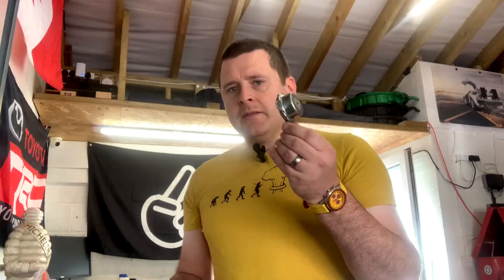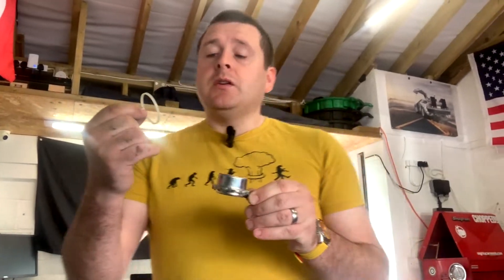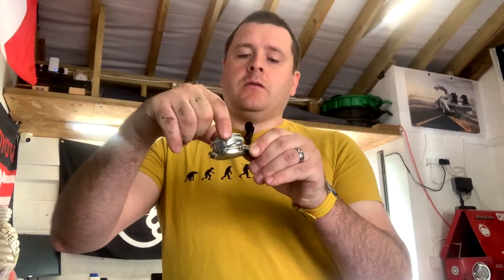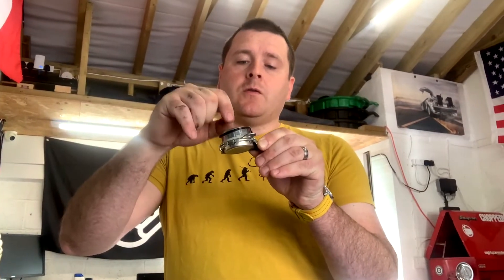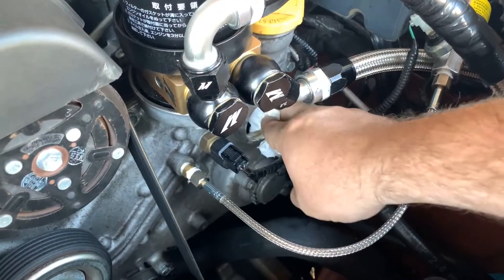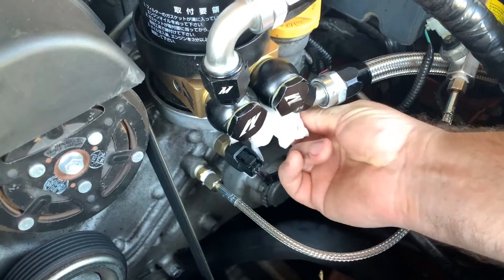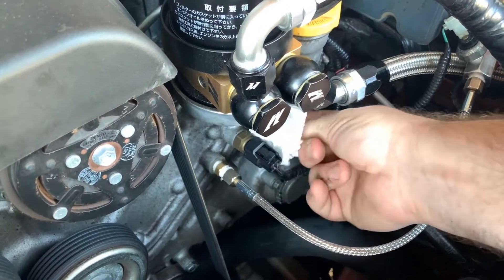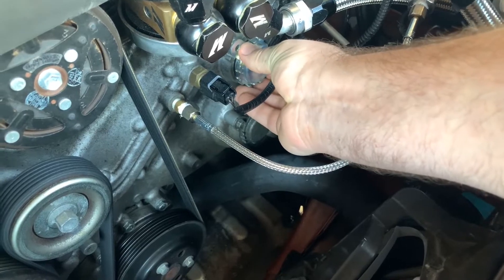I've got to put the new one back in. I'm going to take the new sensor and put the new backup ring on, then we just need the new O-ring. A quick clean of the hole and then insert the new control valve — nice and clean. You just push it in.